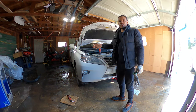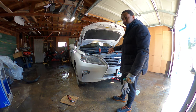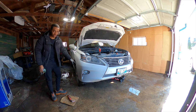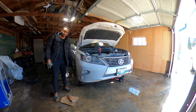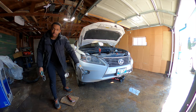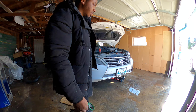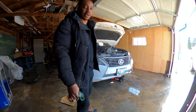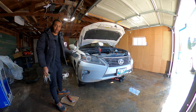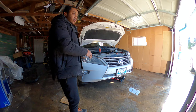If you've done everything right — removed all the plastic off the top by depressing or prying out the clips, like I said before — then go on the side. There are those white plastic tabs with the 10mm bolt in them. Remove that; all this is held by a clip, just gently pry it out. Underneath, under the underbelly pan, there are a couple of 10mm bolts and a clip — pull that out, same thing on the other side. The bumper is pretty much ready to come out. When you bring it out, make sure you undo the wiring harness for the fog lights and probably some sensors back there.